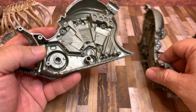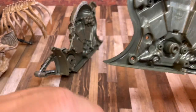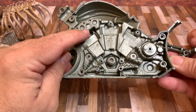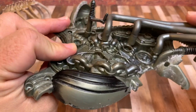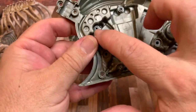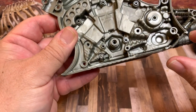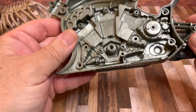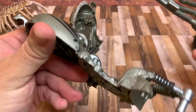On the inside you have three more screws — actually there are seven screws total — and those seven screws, which you'll find here and here, are what are holding the exhaust together, right here. You'll see the screws here, here, and here, and I believe there's one more right in here — one, two, three. Once you remove those, you'll be able to remove the actual exhaust.